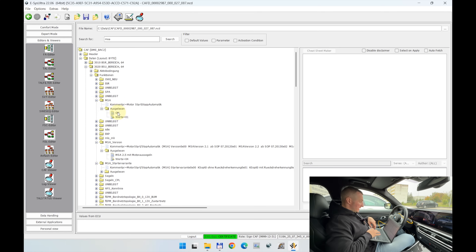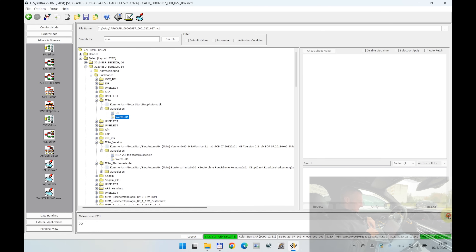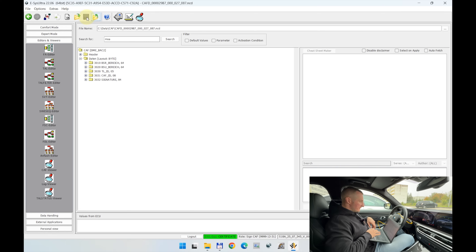That's why we're using the regular MSA parameter. The thing we need to know: if you right-click on it, when it's set to 'only on' you cannot do anything with that value. That's why you go to the word parameter, press Edit, and down here you have to put two zeros. Now click Apply Settings, click Save, and now we have to code the ECU.